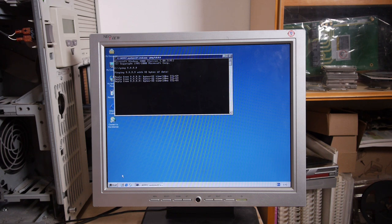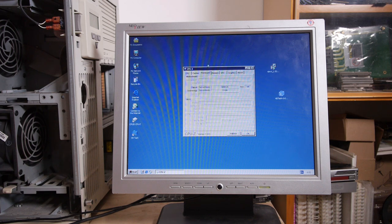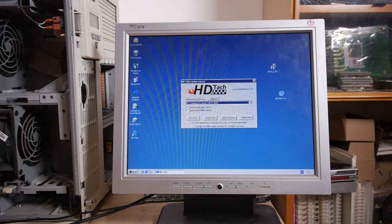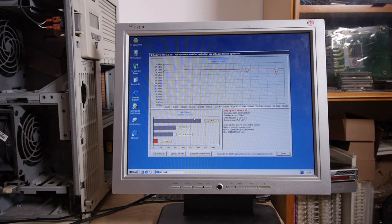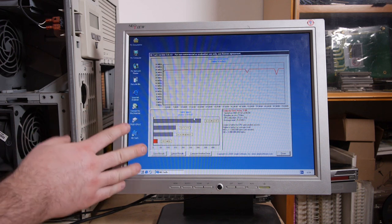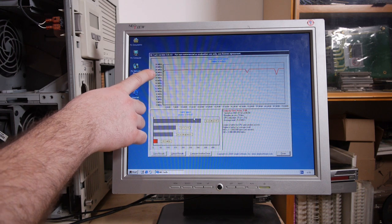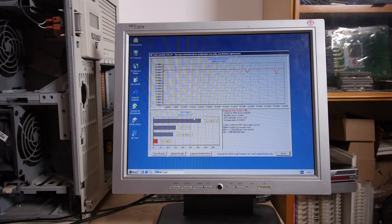The network card is working. Using CPU-Z I can see: Pentium 3 Katmai Slot 1, ServerWorks chipset — that explains the big memory support — ATI Rage 2 with 1 MB. Let's benchmark the RAID array. It's an older-style RAID controller, so it's probably not the fastest. The score is not bad — 14 MB/s for the RAID controller. The hard drives are 72 GB at 15,000 RPM and achieving 29 MB/s with a flat curve. I'm really happy about that.